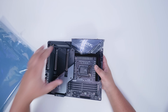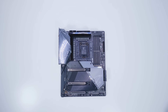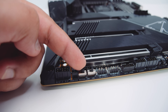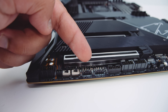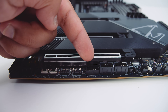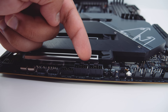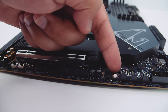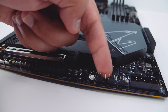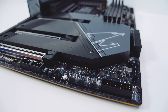Let's take a closer look at all the things on the board. There's a front panel audio connector and a pair of dual BIOS switches. There's a three-pin five-volt addressable RGB header as well as a 12-volt four-pin analog RGB header. There's a TPM header and two USB 2.0 headers for AIO coolers, RGB controllers, and things like Corsair Commander Pros. There's the noise sensor connector for that little microphone, a reset button, and three PWM fan connectors, as well as the front panel connector for your lights and switches.